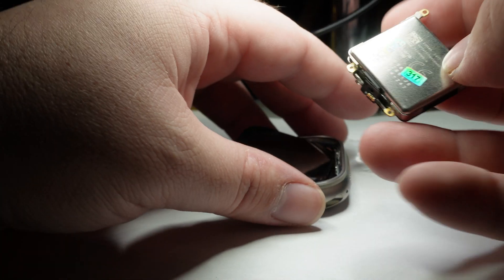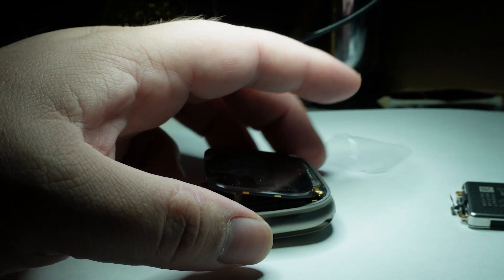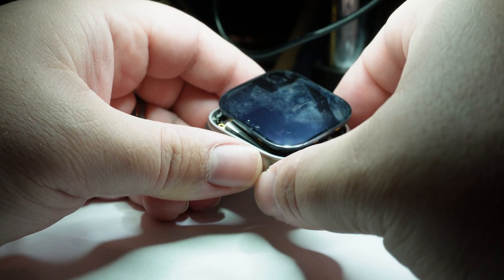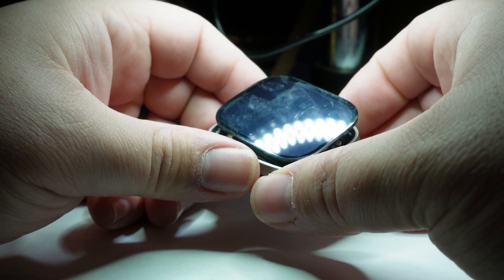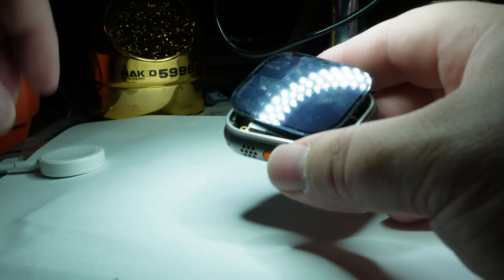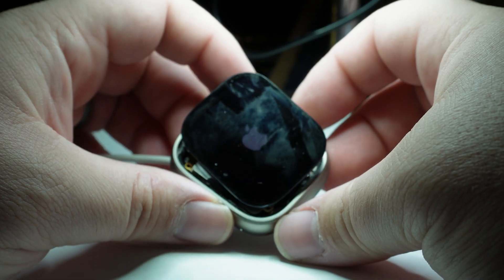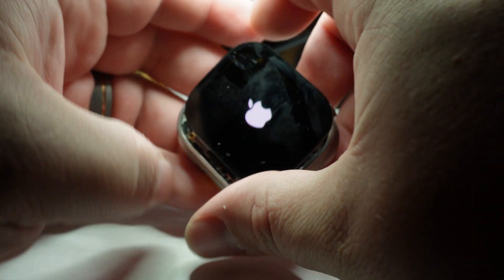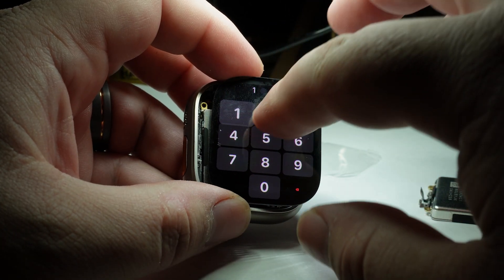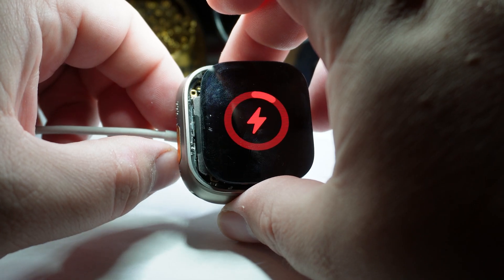I've got a new battery here. Let's open it up and install it. We'll line up the battery connector and connect it up. It's probably a dead battery but we'll click the power button. Let's hold it down — most of the time it won't turn on without activating it with the charger. So let's try that. We got an Apple logo — it's staying on. And if I pull away the charger, look at that, it's staying on. We are on and the display is working, the crown's working. Let's see if it wants to charge — and it does.